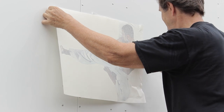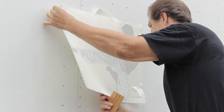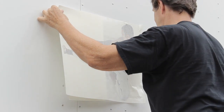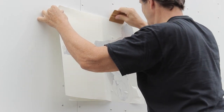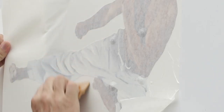There are different techniques for applying vinyl over rivets, which we will demonstrate today. This is one of those proven techniques; in another video we will cover an alternate technique using different tools. Begin by squeegeeing the graphic over the rivets using firm strokes, keeping the angle of the squeegee as close to the substrate as possible.